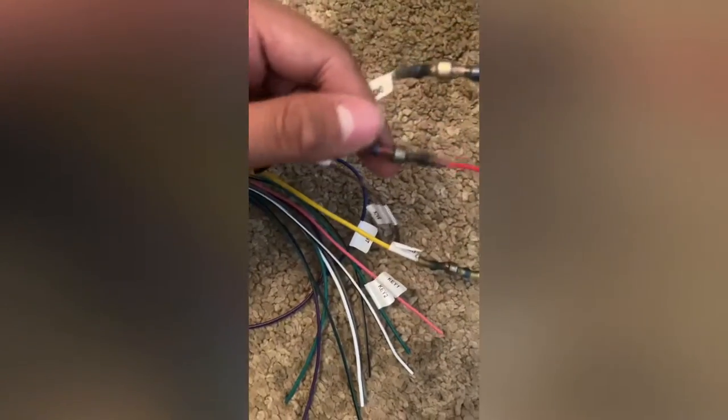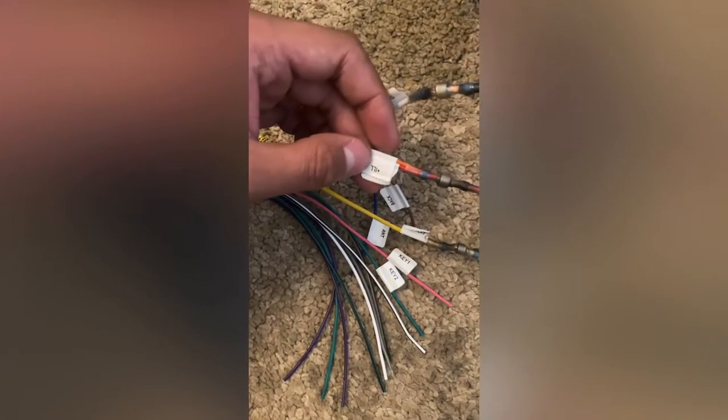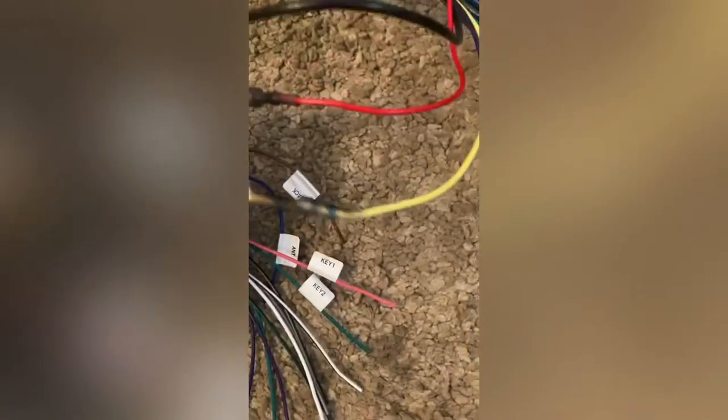This is working on the actual wiring harness. You're going to do black to ground, then illumination plus AC accessory 12V going to the red — so both of those together — so that the radio illuminates whenever the ignition is on. Then yellow is going to be battery to battery. All of this will connect to the back of the unit.